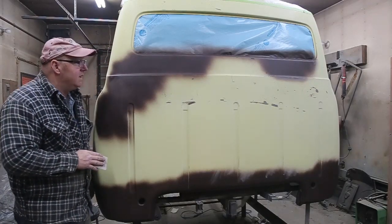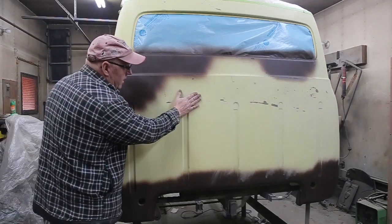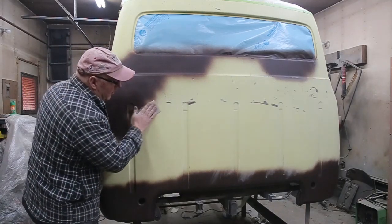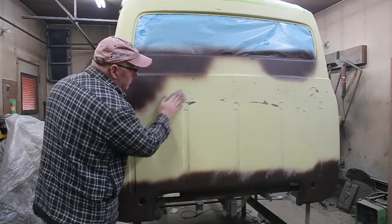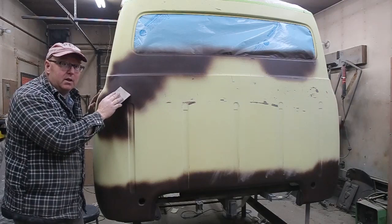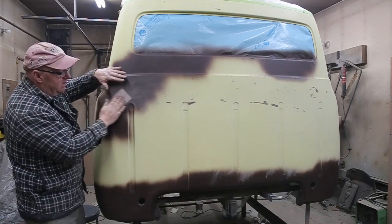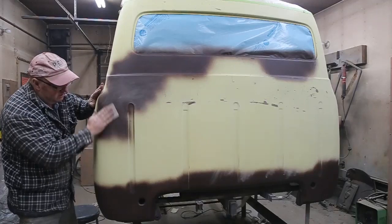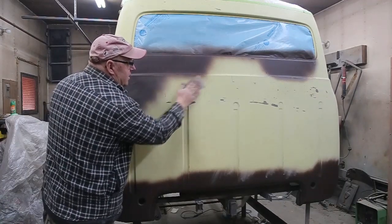It's been a night — I let this dry overnight. You're going to get a little bit of overspray here and there, and since I just want to blend the yellow in, I'm going to use the opportunity to get rid of some of that overspray so it doesn't show up after we clear it. The nice thing about letting it dry overnight is you just give it a real light sand — I'm just using some 400 right here — nice light sand, smooths it off, gets off all the little nubbies and dust particles, and just gives you that extra edge to get a nicer job.